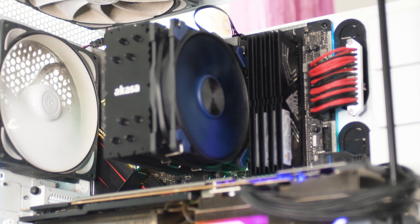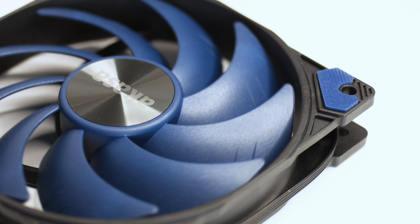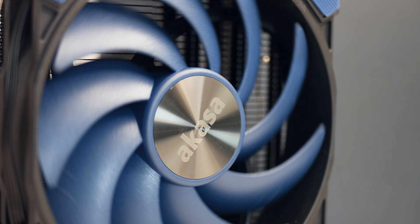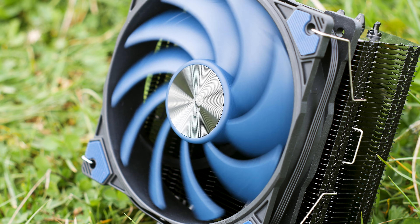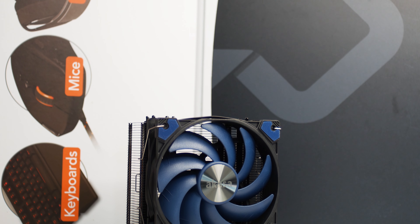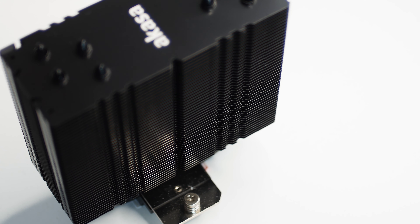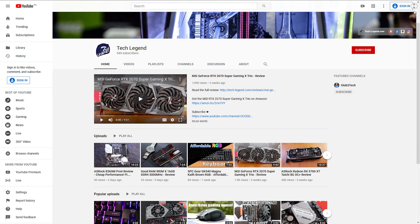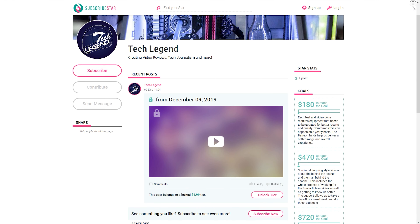The Akasa Aluxia H4 Plus is easy to appreciate for a budget gaming system: it's small, simple, and lacks addressable RGB LEDs — a welcomed feature, especially since you pay less for not having them. The dark blue and black color combination is uncommon and refreshing. If you want the Aluxia H4 Plus with RGB LEDs, you'd be better off buying the Soho H4 Plus and paying a premium for the lights, which offers the same performance overall. As for the 90°C result, that's with an i9-9900K at 5 GHz on all cores — many budget coolers can't even sustain 5 GHz at all, let alone keep temperatures that controlled.